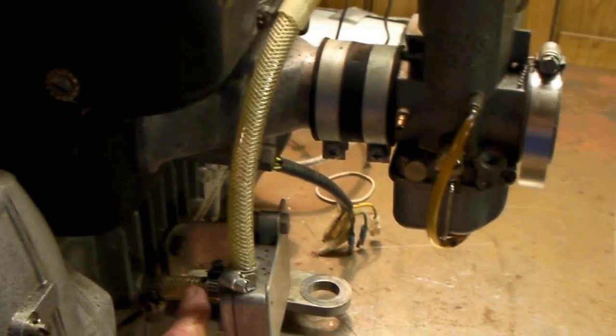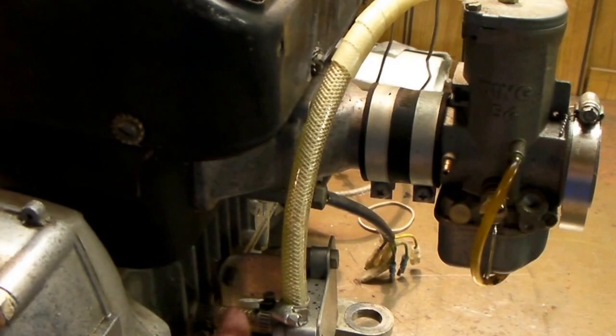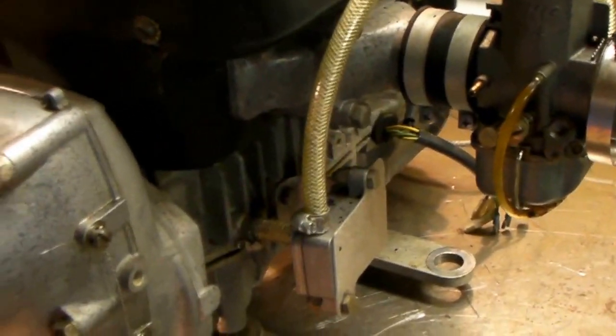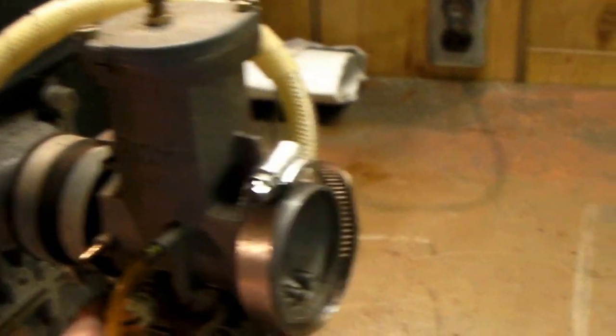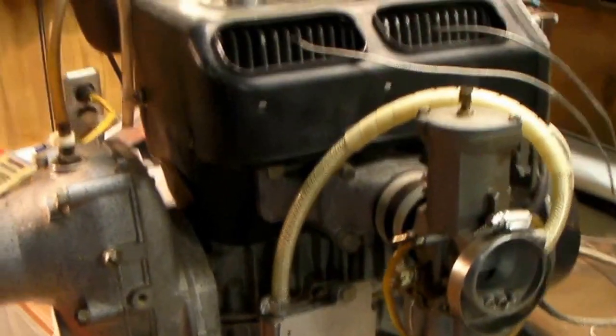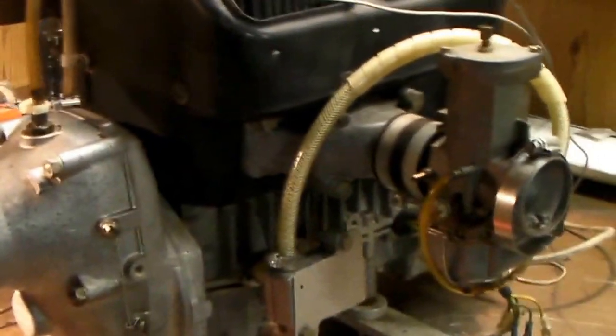Other than that, that's all I know about it. I think the way he has his fuel pump mounted here is very good — it's a short pulse line. Although this line should be changed to the thicker wall line, he has a nylon braided hose in there, which is a pretty strong line. It's short, and if any oil got in there it can run back into the crankcase. The carb socket doesn't look too bad either, although it is old. Beyond that, I'll be taking the cylinders off, painting the air shrouds, checking the rings are free and not stuck, doing a regular decarbon, and measuring to see if it's been over-revved or if there's any bearing damage.